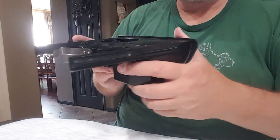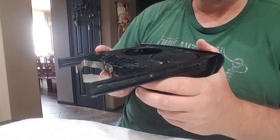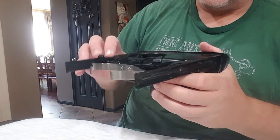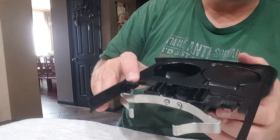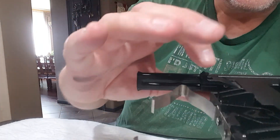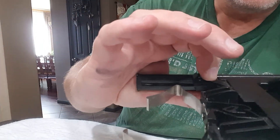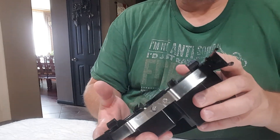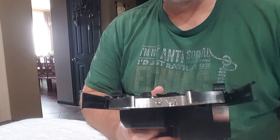When you go to put it back in, put it back in the slot where your ashtray goes and just take your long-handle screwdriver and push down on that tab. It's got these little tabs here - you push down, it'll slide in just a little bit and slide right back in place. Just get your grooves lined up. All right guys, that'll do it.